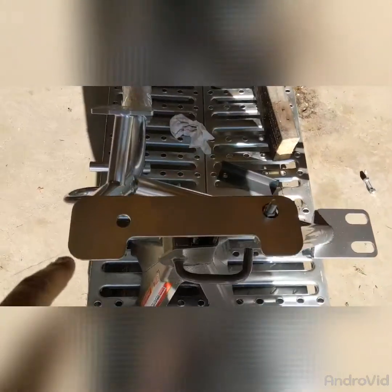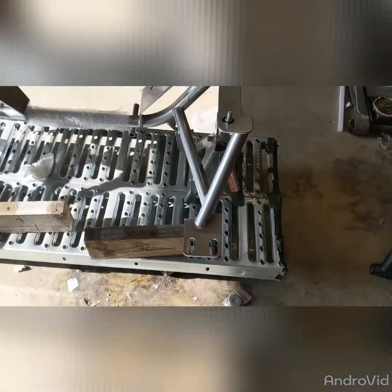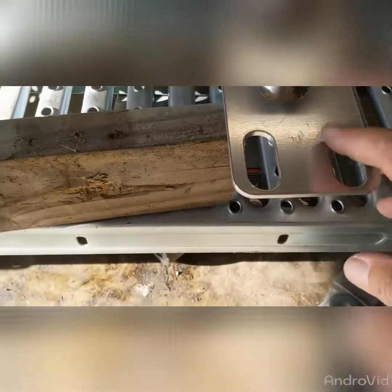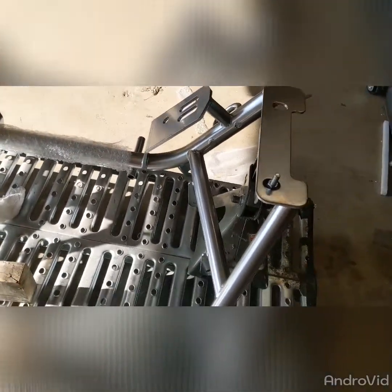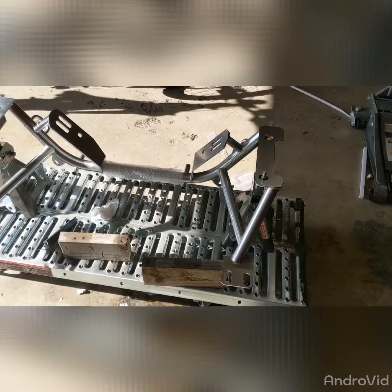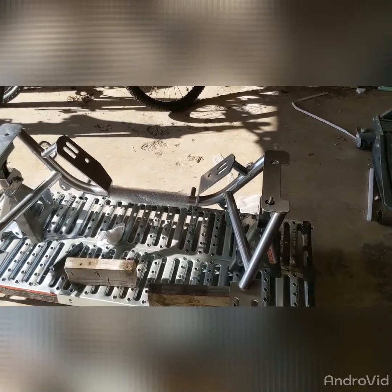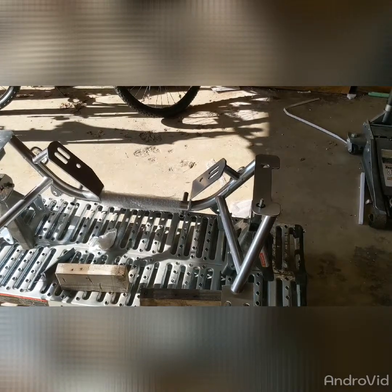These are just pieces of 1-inch angle iron under here. If you can see them, they're on top of the jack stands to distribute the weight and to allow me to bolt just one bolt in place — this one. I'm going to use some plain old strap steel here. In the next section you'll probably see it bolted up underneath. Just a couple of bolts on the inside for support. Basically, I'm trying to position it so that the K-member won't roll about. When you bolt it up into the car, you just drop the jack stands and roll the K-member stand away and you're good.